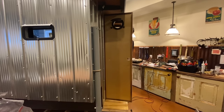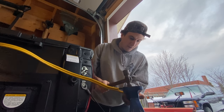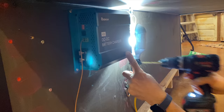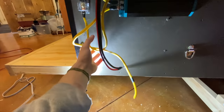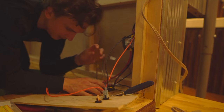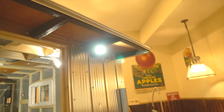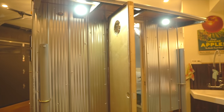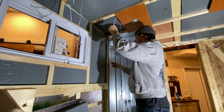At this point I'll be completely honest — I was pretty stressed out. I didn't know how heavy this thing was going to be or if it was going to be road safe. But I started working on insulating the inside, running all the wiring, and building out the interior. Here I'm describing the DC-to-DC charger — the wires go from the starter battery into the DC-to-DC battery charger, and those cables will charge my battery to run my lights. Because I was getting more stressed I started filming a lot less, which is too bad because this is where a lot of really cool things came to life. All my lights are LEDs and I wired them all in parallel.